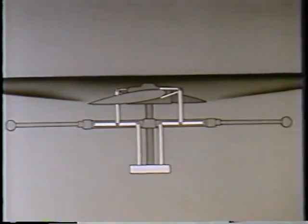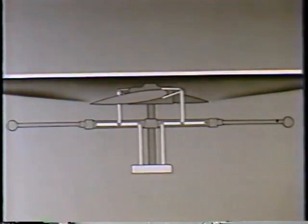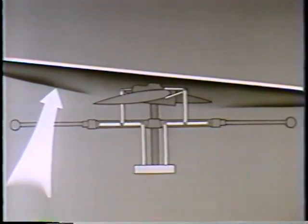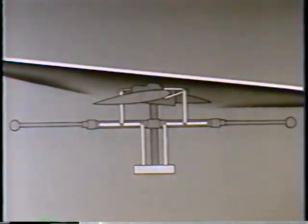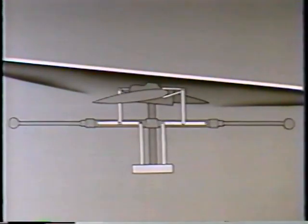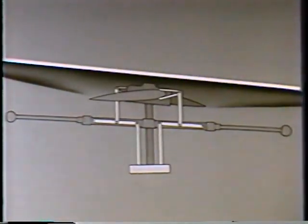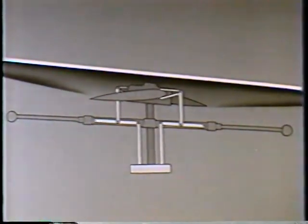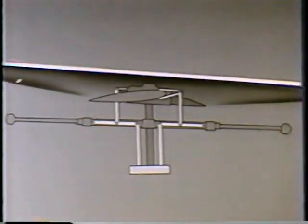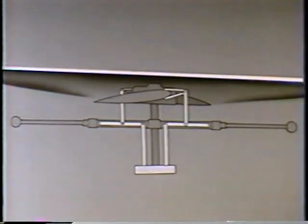The turning rotor produces the rotor disc. If a sudden gust of wind strikes the rotor blades, it may succeed temporarily in altering the attitude of the rotor disc. But any resulting movement of the controls will be absorbed largely by the stabilizer bar as it resists displacement from its normal plane of rotation. The bar will store up the movement and then dissipate it slowly as centrifugal force causes it to return to its normal plane of rotation, which is 90 degrees to the mast.